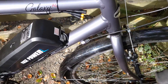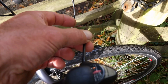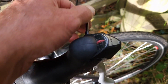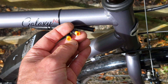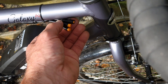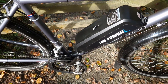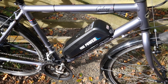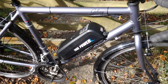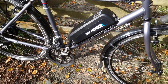This bike did come with brake cutoff sensors, but because this bike has STI levers fitted I couldn't fit them — however you can get inline sensors that fit on the brake cables, and they will supply those if you ask them from their website. The throttle connector is there, but the throttle on this particular kit is set to six kilometres an hour, so it's not really worth fitting in my opinion. The pedal assist works really well — it kicks in as soon as you start pedalling and stops as soon as you stop. So I don't really see the need for the cutoff sensors, though it is a useful safety feature when negotiating tight bends at slow speed.